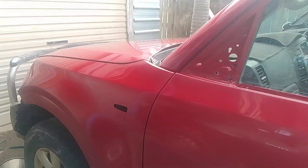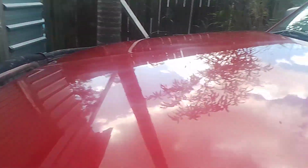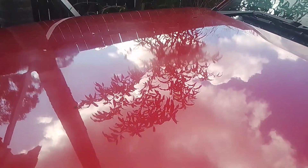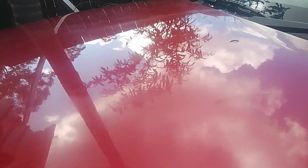I'm going to touch up on this Mitsubishi Pajero. You can see the middle — can you see how it's all hazing over here? I've cut through. The edges are okay, but when you're painting these guards you can't touch them, you have to get your gun to an angle. Look how horrible that is — over here I've cut through the paint.